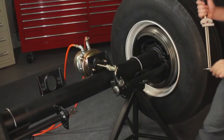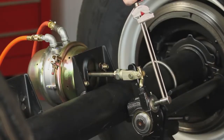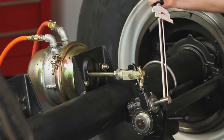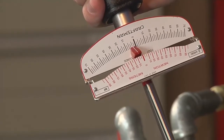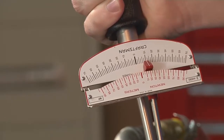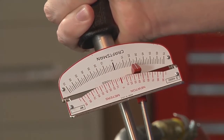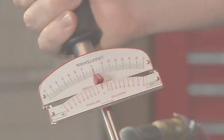Now let's look at torque. You can check the clockwise and counter-clockwise torque by attaching a torque wrench to the hex extension and turning it in the clockwise and counter-clockwise directions, recording the measurement. The clockwise torque specification is a maximum of 10 foot-pounds. The counter-clockwise torque specification is between 15 and 50 foot-pounds. If either of these torque specifications is violated, then you must replace your Gunite automatic slack.